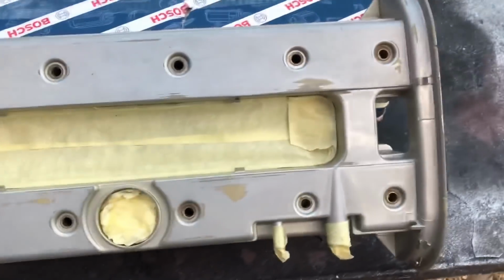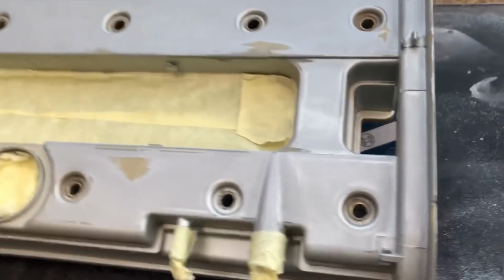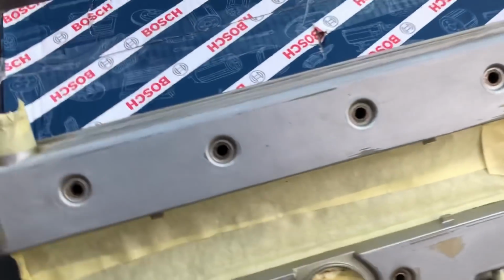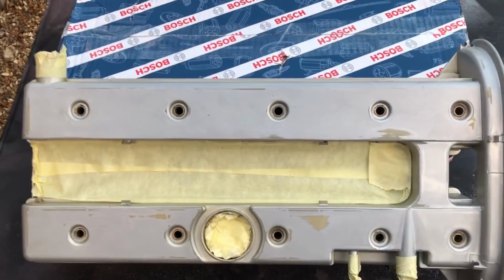It's all been sanded down. It's been fully degreased about 3 times now because I didn't want to get any silicone fish eyes. So I'm just going to give it a thin coat of plastic adhesion promoter and a dusting of Etch primer, and then we're going to stick some base coat over it.